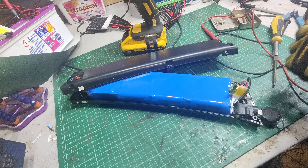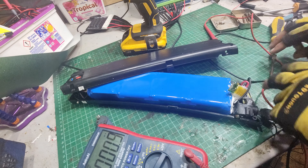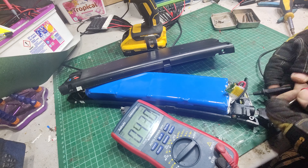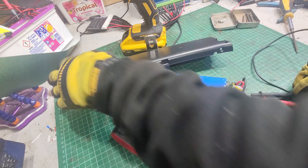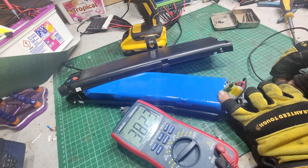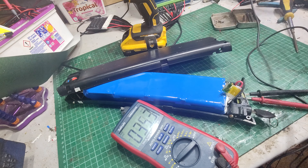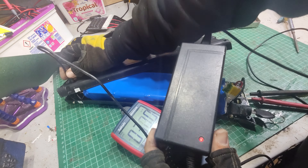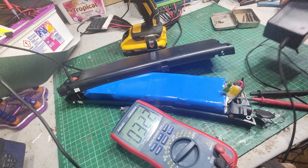There's evidence of a lot of CA cyanoacrylate glue in there. Fuse is intact, which is good. So there is an internal fuse if you find it's not putting out any power. Let's see if this has got any voltage - 38.23 volts, which is, you know, on. Let's get our 36 volt charger here and check that, make sure it's charging. It is charging - it just changed its mind. Fair enough.